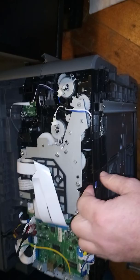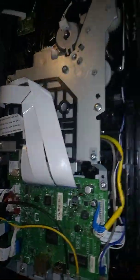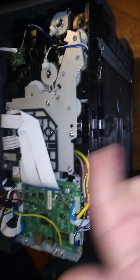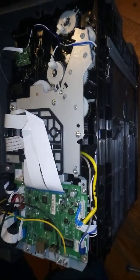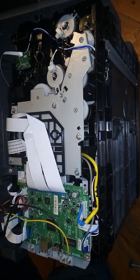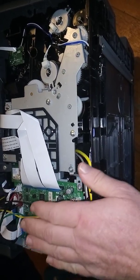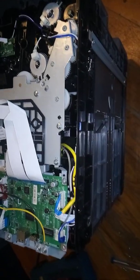When the laser motor gets old, the bearings become sloppy and the motor starts to draw more current from the power supply. With the safety devices built into these machines, this blows particular fuses. So the OB error on this model of printer is caused by a fuse that blows.